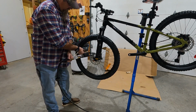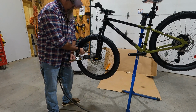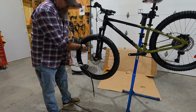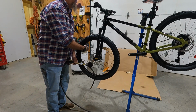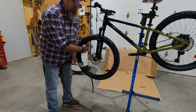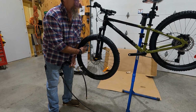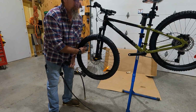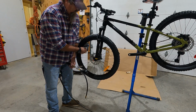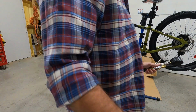All right, there we are. Press the valve, you screw the stem back in, and then the little nut on the bottom of the stem, well, because there's air in the tube now, there's going to be a gap there. So go ahead and run it down finger tight, because it's going to come up off the rim. All right, we'll air the back one up and move on.